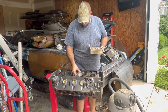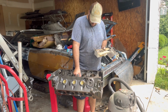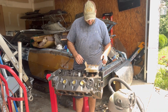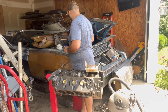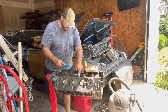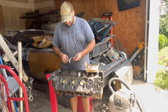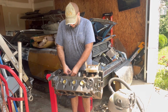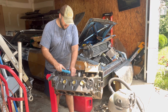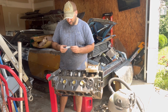Anyways, you gotta make sure you get your oil where it goes. That'll be fine. Right like that. I just tap that down a little bit. Something kind of soft. Just tap it down flush. I like that. Still got a good oil ring. Now then, let's take this one, do the same thing. By the way, it's impossible to put these in wrong. You got a little groove that sticks out. And these are just standard size bearings.